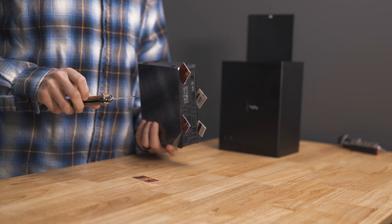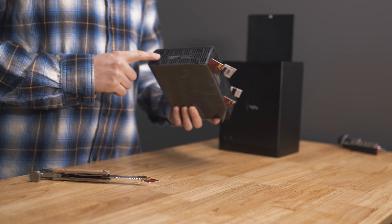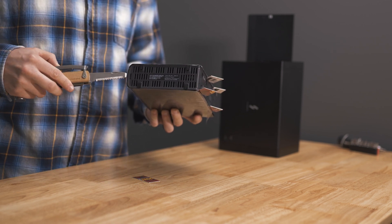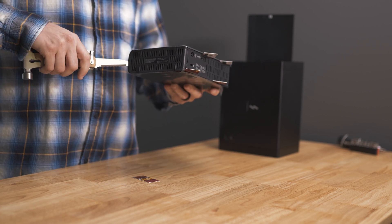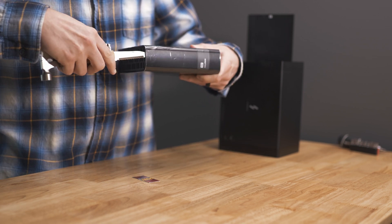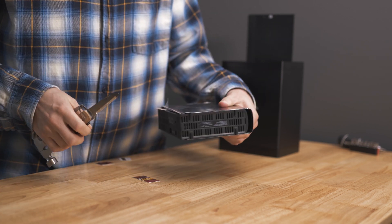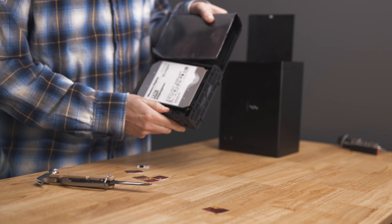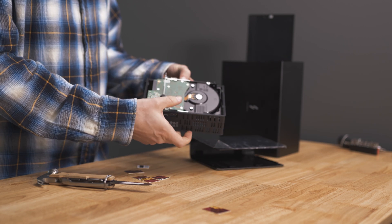Now that you have all four pieces in, you're going to need a flathead screwdriver with a little bit of an edge — I found that was the easiest way to do this. Along the top and bottom of the hard drive, right where the front of the case is, you're going to want to dig the screwdriver in and continue to separate that inner piece that holds the hard drive. When you put your screwdriver in, you'll pry it open until you hear a pop and you'll create a pretty sizable gap. Don't be afraid of that pop — that just means you've separated it. Once you do that, your credit card pieces will just fall out and you can slide that inner piece right out of the plastic. Then just lift up on one side of the hard drive and it'll pop out of the case pretty easily.